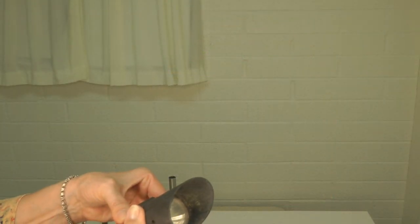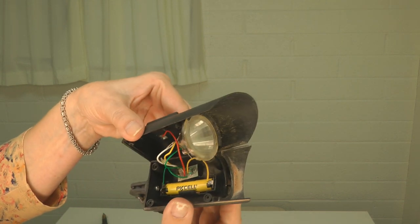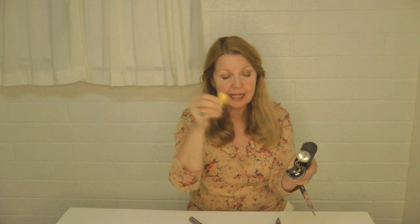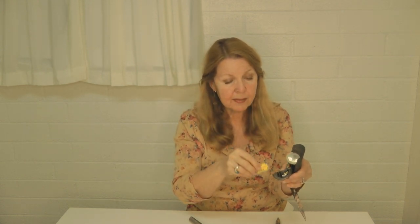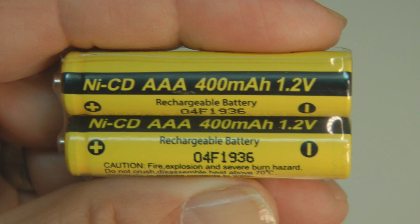First, I undid the four screws on the spotlight and you can see where the battery is. You sort of need to jiggle it a little bit so that you can pop the battery out — and the battery is out. Now I can take the brand new battery and insert it into the spot. Make sure that you pay attention to where the plus and the minus end go.